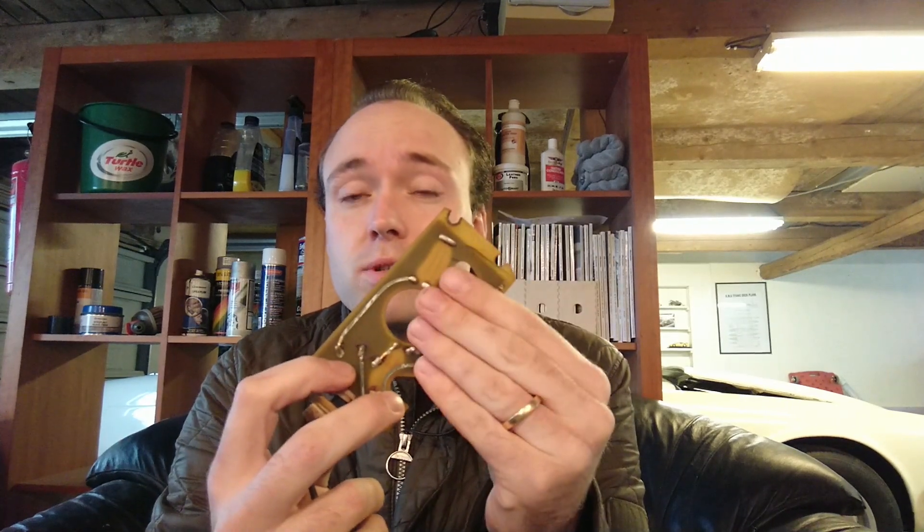It's a good system, and you can replace this on the side of the road and get home. This has to work for the engine to run, so it's a great piece of preventive maintenance to make your car more reliable. This can also cause some issues with running — let's say your car may run great when it's cold, but once it gets warm it can be a little iffy and lumpy and uneven. That could be these reed switches going bad. So if you have the original one, it's really easy to tell — look at your distributor and the cable going out from the trigger board. If it just has three wires like this one, you have the original reed switch one and I highly recommend that you replace it.